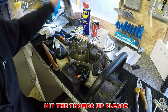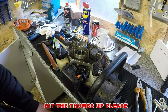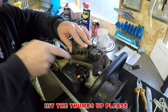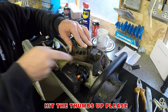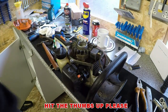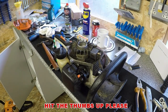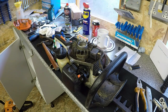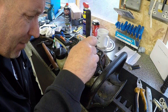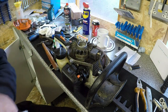You can use spray grease and that sort of good stuff. So, a bit of carb cleaner on there, and a wire brush. I've got 2 or 3 wire brushes now. And then my magnet, just to pick up any bits of stuff I've got in there. Let me just find my magnet. Should be in the top of my tool chest somewhere. There she is. Just to pick up any bits that have come adrift from the wire brush. There's a bit there which I won't get, because the magnet on the flywheel is actually stronger than my magnet.